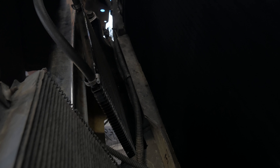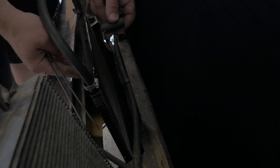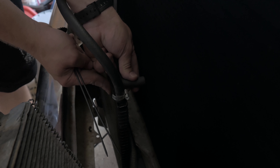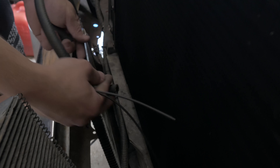Something I forgot to mention: you're going to have to cut the little air dam in here. It's very soft plastic — I just used a hacksaw. You're not really going to affect much aerodynamically, and if you have a front hitch, you're already totally screwing up the front end. To actually have a secure hold on the cooler, I cut these little about inch-and-a-half long pieces of hose and they're going to be spacers against the condenser, and that's going to keep the cooler from getting all banged up on this metal.